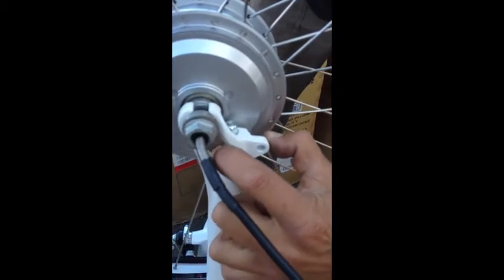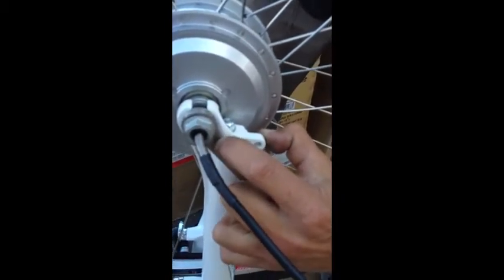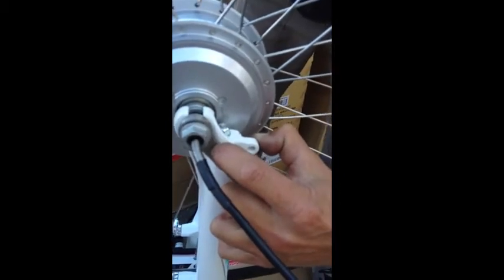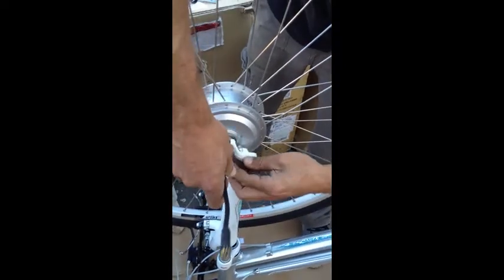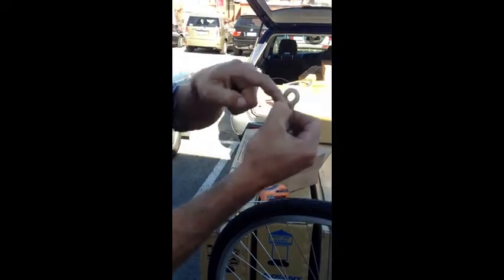Typically I'll put it in a vice about 3-4 mm away from where I want the bend, and clamp it there because the bend always comes a little closer to the bar. If you mess it up you can straighten it and start again. I also have adjustable ones — this is a very generic shape of the fork but it doesn't fit all bikes, and I can provide you with adjustable ones. So first we'll take this to the vice and aim to get a bend. Make sure you get the orientation right — put your fingernail about where you need it, then put it in the vice and bang it with the hammer.